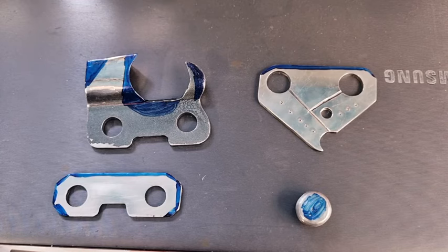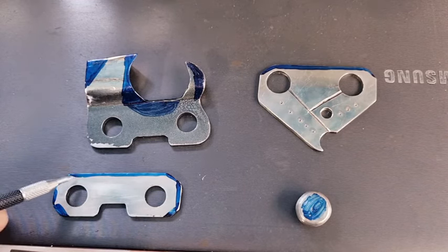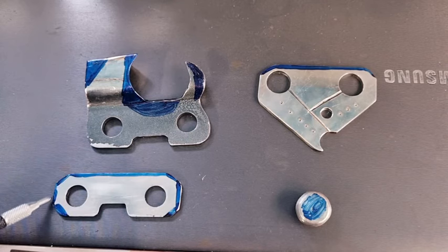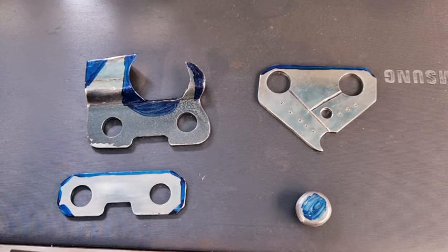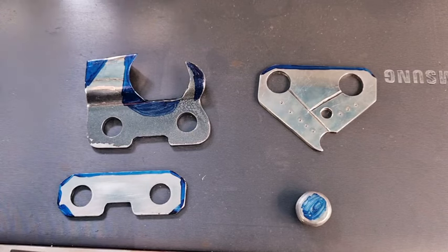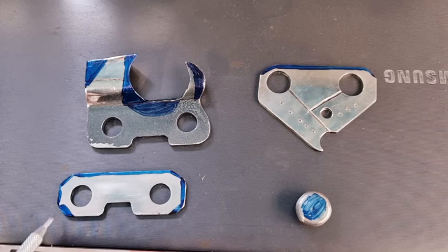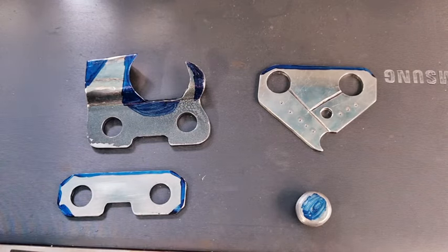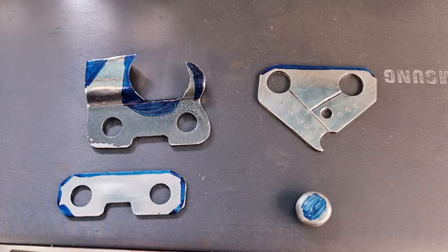The other thing is the tie straps. They file the edge and put a 45-degree bevel on it, and a lot of them will even file all around. They call it clipping — toe clipping or heel clipping — to reduce weight. This is the toe and this is the heel. So they file around the whole lot to try to reduce weight. Some race chains are reduced by 15% in weight, which is quite a lot. And it's always full chisel, square ground.